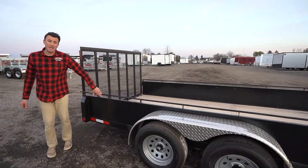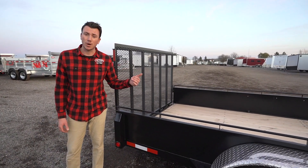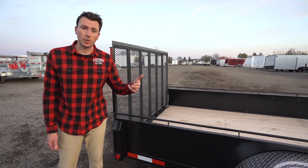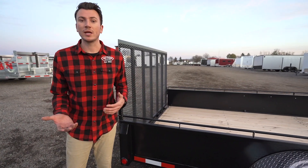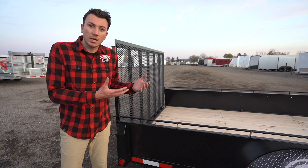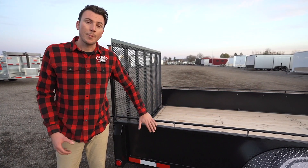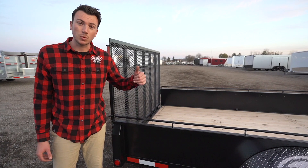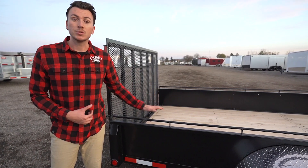On the side of the trailer, as far as paint, we upgrade the paint right off the bat. The process is an acid wash, then it's primed, then it's powder-coated. A lot of trailers in the industry neglect these three processes, and that's why they're rusting away in the first year or two. Obviously we live in Ontario, so there's always going to be rust with salt and calcium chloride on the roads, but having a better paint process — acid wash, primed, then powder-coated — is going to certainly last much longer, and that's what we do standard.